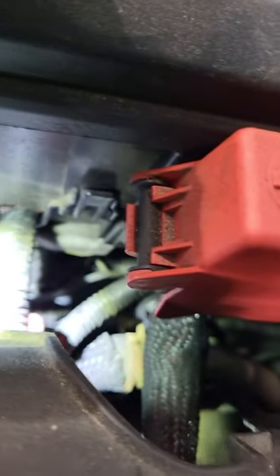There's an upper torque mount that's broken back here too — if you can take a look at that underneath the battery. I just noticed that. I thought I felt some motor mount issues. So if you look underneath that wire harness, you'll see a tear.